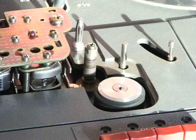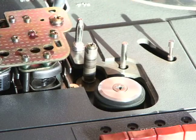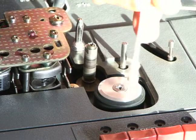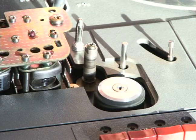Let me show you briefly what I use to clean the pressure roller, because it's rubber. A lot of the alcohols — isopropyl, ethyl alcohol — will actually harden this rubber, and I don't want it to harden. So I tend to use simply water. We'll use that and I'll show you how to do that next.